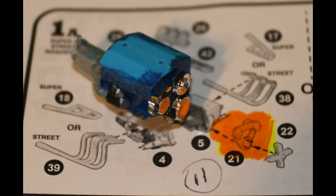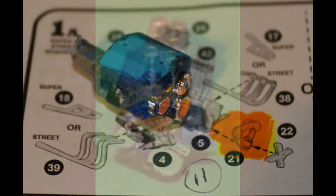With the motor parts all dry, I started to assemble the motor, and it seemed that the fan belt assembly didn't fit the way the instructions showed them to be placed. So I rotated that slightly, and I put the fan pulley at the bottom and the crank pulley off to the side. So I turned that by moving the alternator to the opposite side, and then the fan pulley at the top and the flat crank pulley at the bottom. It just seemed to fit better, and as long as the parts are in place, I guess that's all that counts. So that's the way I left it for a good fit.